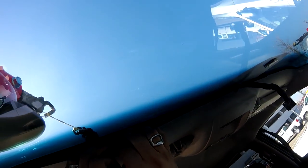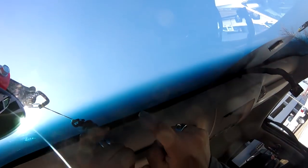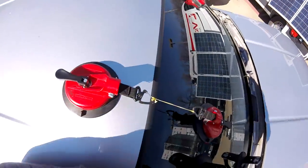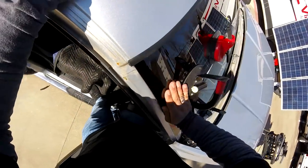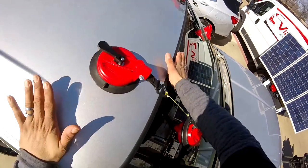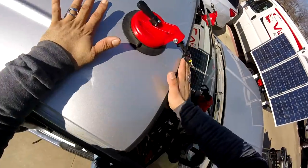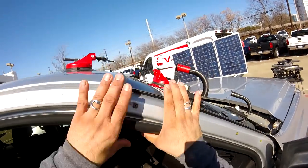You see? The bead, I have to push it down, but it's really nice, because when you put your fingers in, you cannot go deeper than half of your finger, it's nice. When you go inside almost the whole finger, that one is too high for the molding. So now we're gonna push it down. Remember, when you're pushing down, just try to go slow, because you can break it exactly at this point, and this point, because this molding is not for this vehicle. You can break it.